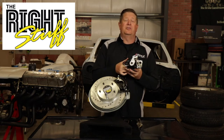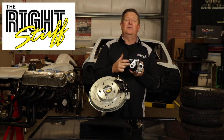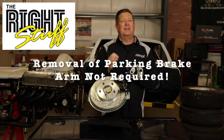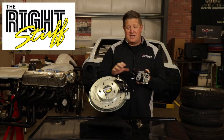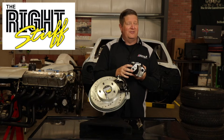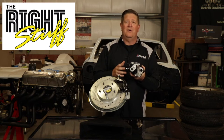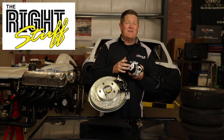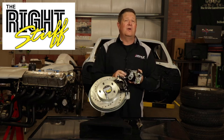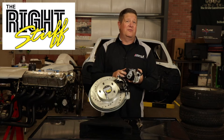There are videos out there that show you removing the actual spring and also this arm to adjust this parking brake. You can do it that way, but it's not necessary. Not only is it not necessary, but if you do that while it's on your workbench and not on the actual car with brake pads and a rotor installed, you can actually release springs inside this mechanism — either this can push out or the piston can push out. GM didn't design it to be adjusted that way. It's really taking more apart than you need to and it's a pretty straightforward procedure.